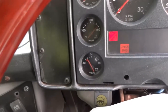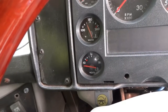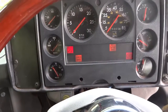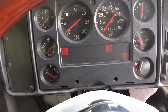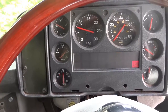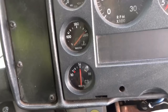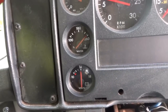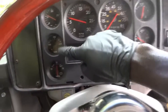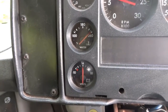Let's confirm it by starting the bus. I just turned the key on right there — the gauge just shot up. Now let's start the bus. It started, but watch this: the temperature gauge is reading 260 degrees Fahrenheit. Luckily it started pretty easily, but the driver said sometimes it's difficult to start once the temperature gauge is up at 260 degrees Fahrenheit.